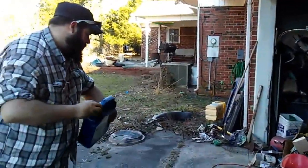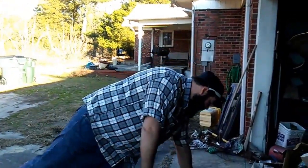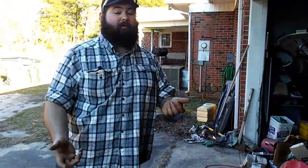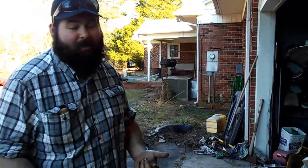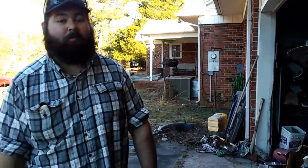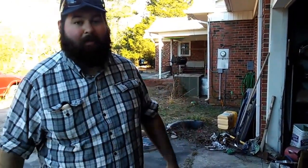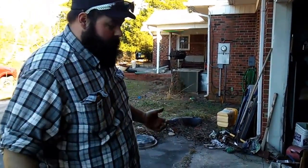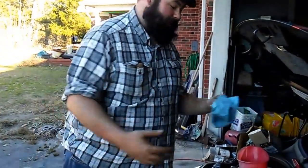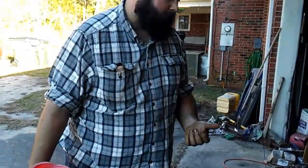And it's just that simple, guys. There are a few steps to it. It is a little time intensive because you're using a vacuum pump. If you have access to a lift, by all means. There's like 6 10mm bolts that hold the under tray in place. You can drop those, get to the drain plug like that, and it can be a lot quicker. The biggest pain and time consuming issue outside of getting the oil out is actually getting to the filter. And once you've done it a few times, it's not that big a deal. It is a small car, so packaging is kind of at a premium.